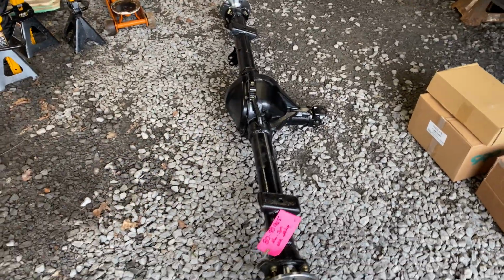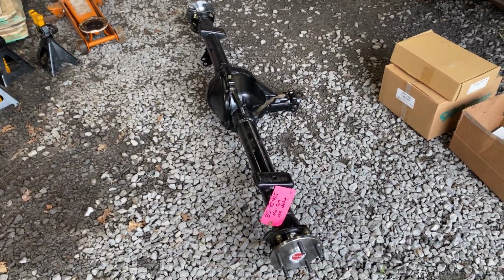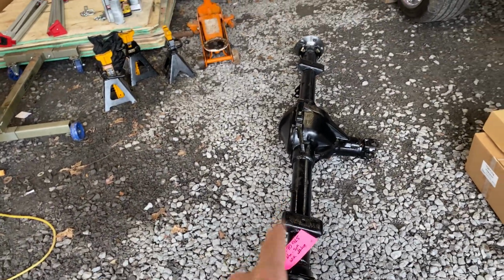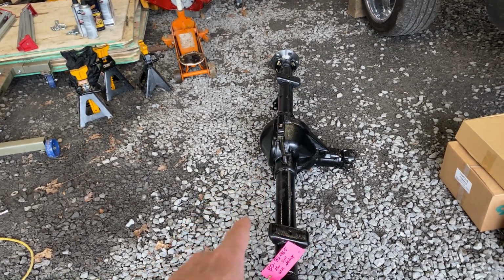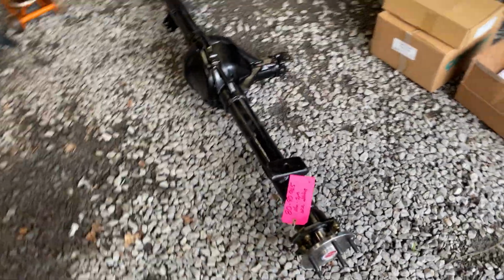I took it to Hudlow to have new bearings and seals put in and freshened up. And the thing had been sitting in the rain because the cover was off. And Hudlow said every piece of it was bad. So anyway, we now have 30 spline Moser axles, a brand new Posi 373 gear, Yukon gear, and put the Ford 9s on the end to get the C-clip eliminators.